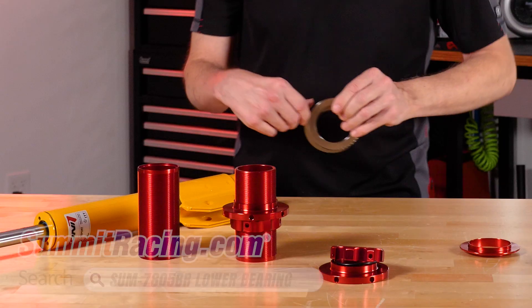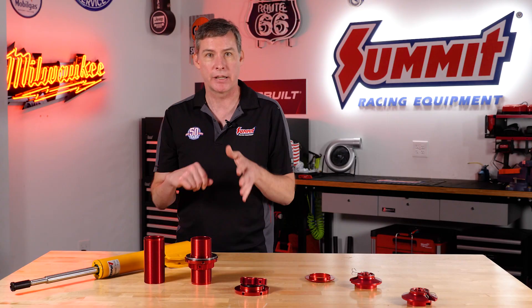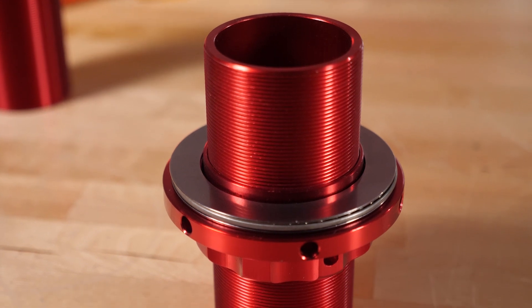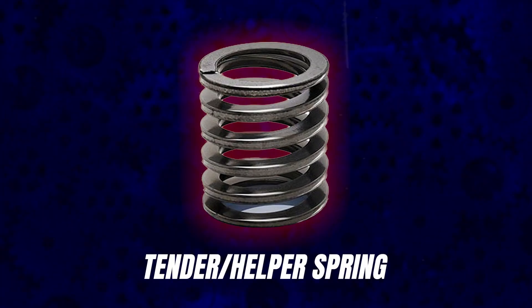Say you have a really high-tension spring — we've also got these cage bearings for the bottom, so not only can you have them at the top, you can actually have them at the bottom as well. It takes a ton of friction out of the system, allowing you to get really precise, accurate measurements without tearing things up.